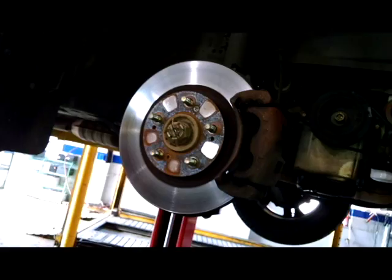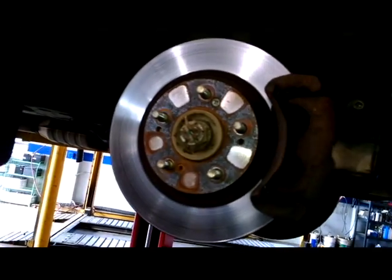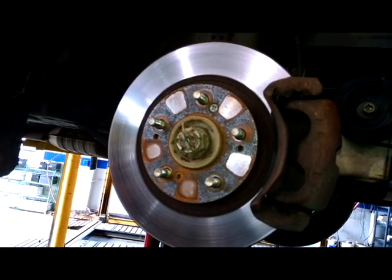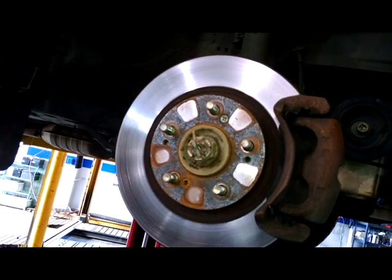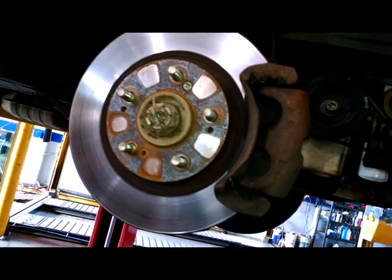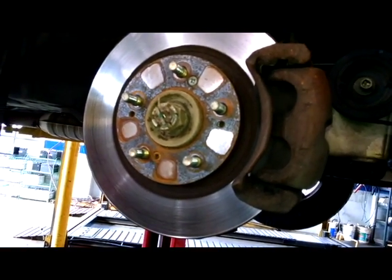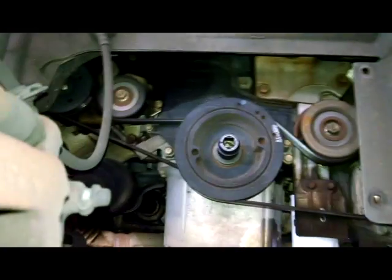And taking the tire off is pretty easy. 21mm lug nuts. Break them loose a turn. Jack up the vehicle. Take them off the rest of the way. Use a jack stand. Use safety stands to protect yourself so it doesn't fall on you. You don't necessarily have to do things in order.